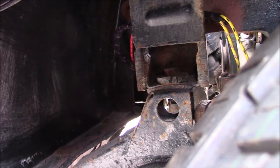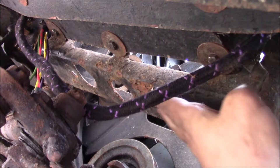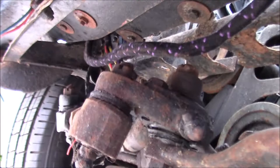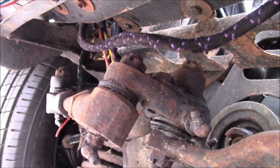So you've come from the engine bay through into this box section, branched off for your headlights, and then across and down. When you come down, this is the radiator bracket where the radiator sits, and the wiring loom wants to sit here. Originally when I took the wiring out it was cable tied to this, but I wonder if it's supposed to be on little p-clips on these bolts here. That would certainly make sense. And that runs all the way across to the other side, with a branch off for the stator tube, and then branching off to the column and everything else.